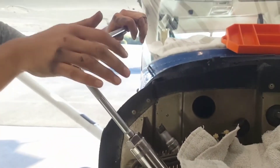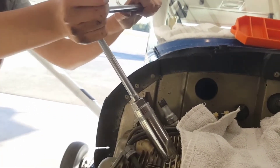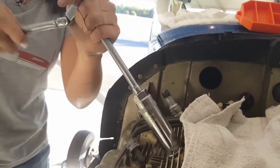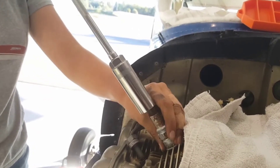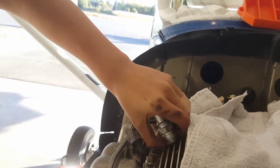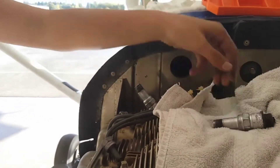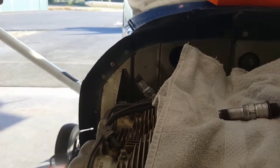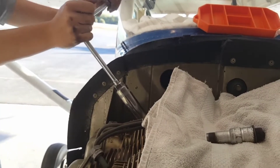When planning this oil change and spark plug replacement, it's not something that has to be done together — but when you're doing maintenance on the airplane, you look to see what else needs to be done. The spark plugs needed to be changed and so did the oil, so why not do them together? It's helpful to only have to uncowl everything once and do all the work in one instance, especially if it's something fairly small within the span of an hour.